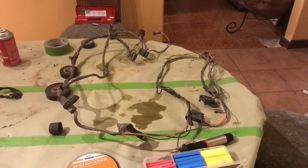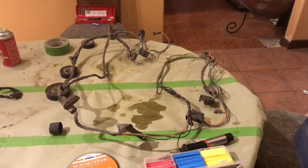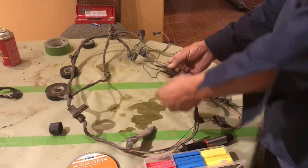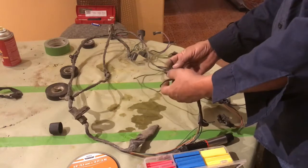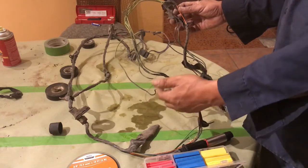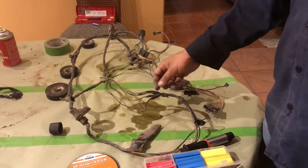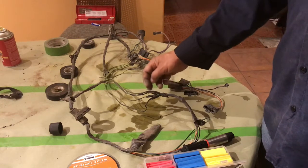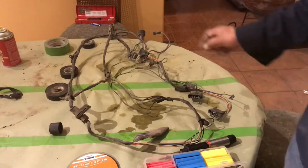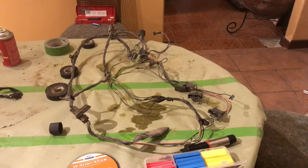Inside the cab under the dash, there's a wad of wires I removed that used to belong to the radio. They did a whole bunch of splices here — the wires are not color-coded anymore. They put in all green wires and tied them off. Why they did that, I don't know. Since they probably just twisted the wires together, I'm going to cut into all these, expose new wire, solder them, and put shrink wrap on them to give a better connection. I'll clean all this up and tape it so it looks a lot nicer.